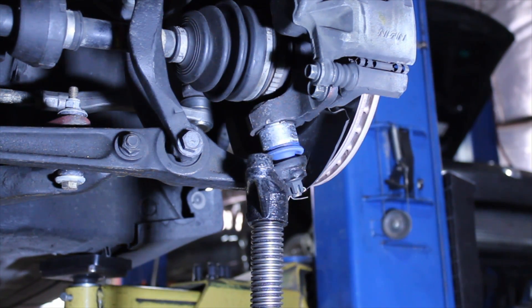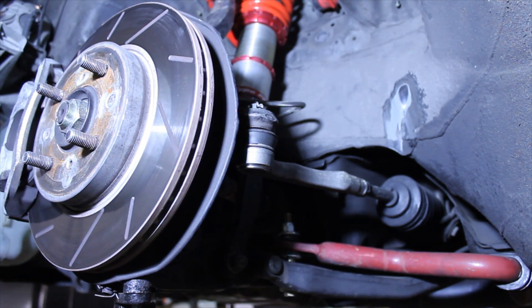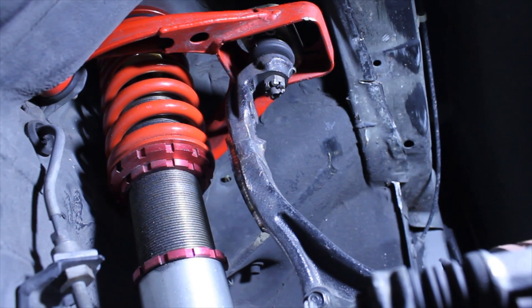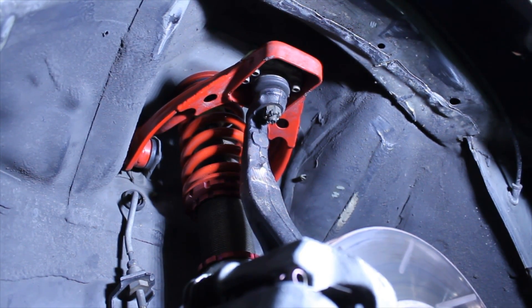These mods were designed around a Buddy Club ball joint, trying to use the Buddy Club to its full potential by also changing the toe angle and changing the upper control arm angle. So now the front end of this car is actually a more domineering factor of the car. The rear end is more subservient and actually responds and follows the front of the car much better, so it's actually a way better cornering car than it was.